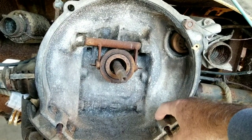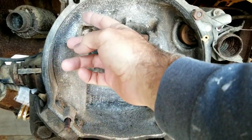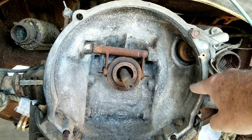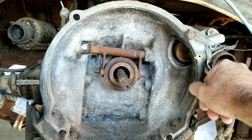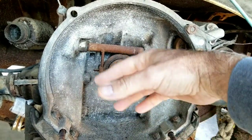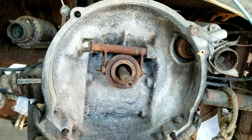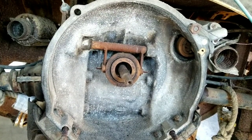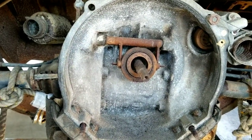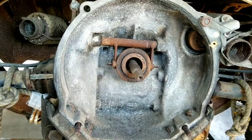It's usually right here, right in this corner, in this part. There's a little bump right in here and right over here — you can kind of see them. When you have the flywheel out, make sure you leave this machined edge. This is a 12-volt trans, so this is a good way to show you what the 12-volt one looks like so you can see what you have to do. I'll talk to you guys in the next video. Hope that helps you get through that little process. Please like, share, and subscribe. Do it at your own risk — be careful. Remember, it's magnesium and it can catch fire. Keep that in mind.